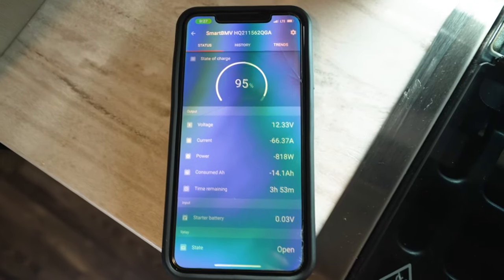I worked these things out one day and I dropped the battery percentage to about 50%, measuring it with a Victron Energy shunt. Now a shunt, if you install it properly, measures the amount of power going in and out of the battery, everything that's going in and out, and it will properly measure your battery capacity versus using just pure voltage to say, it's 12.0 or 11.9 volts, it must be this capacity. It's actually measuring how much power is going in and out, and it knows the capacity of the battery. So keep that in mind as well.